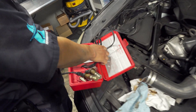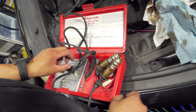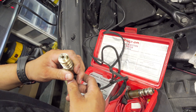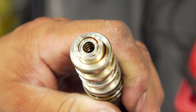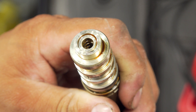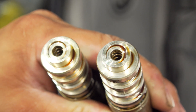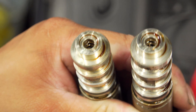I've got an injector tester from Snap-on — an old-school one — that gives me the option to manually open and close with the press-over button, because the pulse mode is much too fast for what we need. I'm going to manually actuate this VVT solenoid — when I let it go it slowly retracts. When I go to the good one, the exhaust one, I actuate it and it retracts immediately. The bad one slowly comes back down.